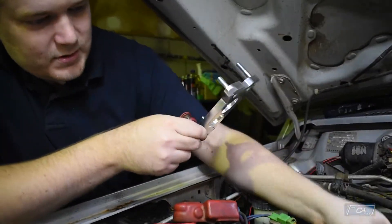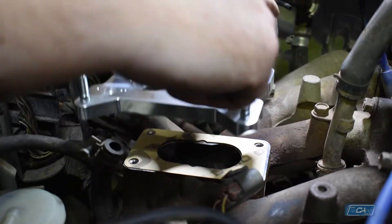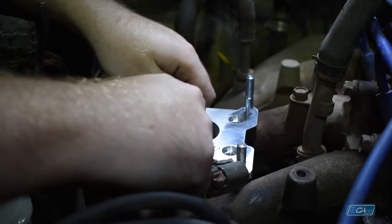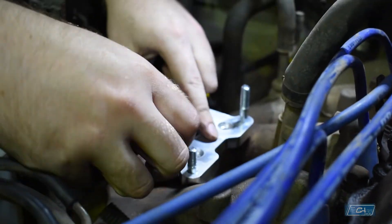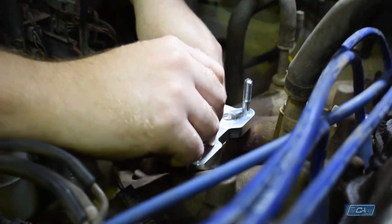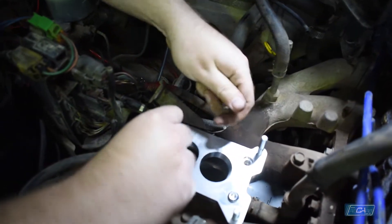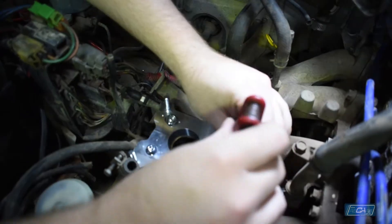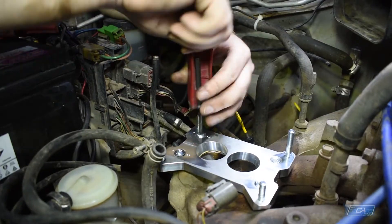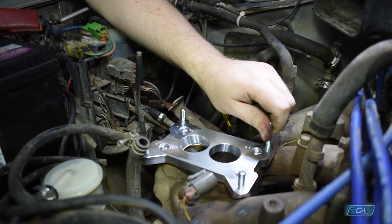With the TB42 it may seem like there's more than one way to put it on, but there's not. It will only fit in one orientation — that's the longer screw towards the back, towards the engine. The plate comes pre-ground so it clears this runner here. Put the screws in — you should be able to feel a little bit of wiggle. That's the easy part done.